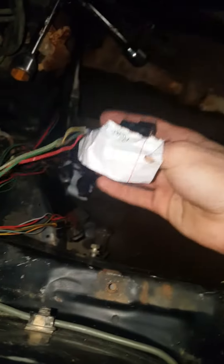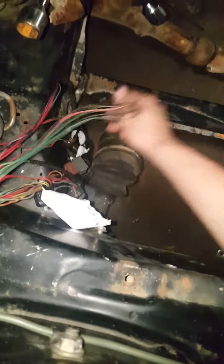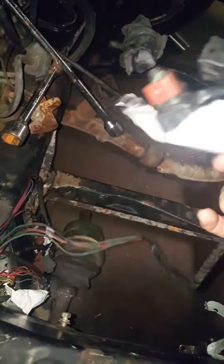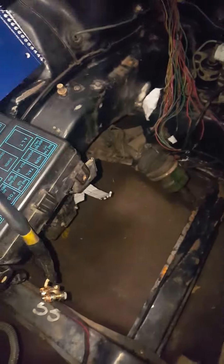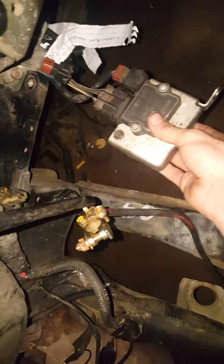You'll need to mark all these connectors. This one is for the rear injectors, this is for the knock sensor — I've pretty much memorized where all of these go from pulling engines so many times. This goes to the driver side of the intake plenum for the idle air servo, which if you're twin turbo you won't have. Your coolant temperature stuff will run up here, and I'm running it down under the fuse box so it's out of the way but still clean.